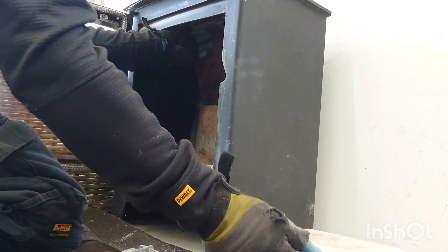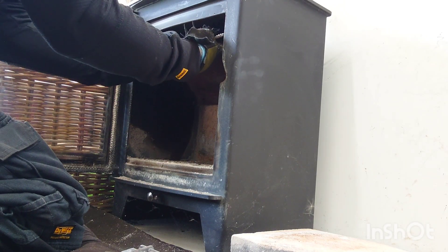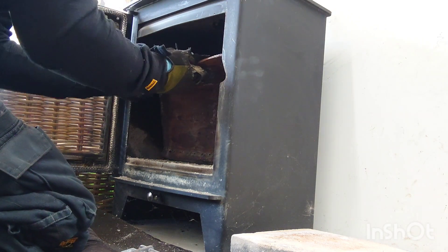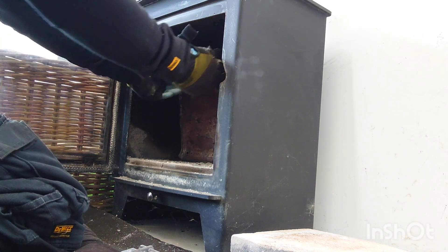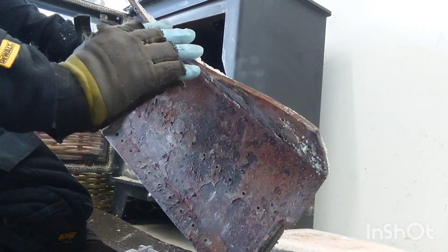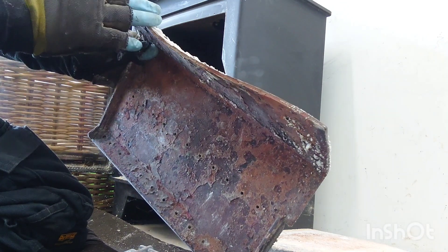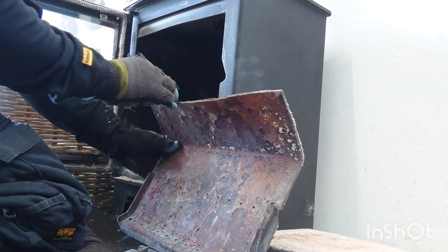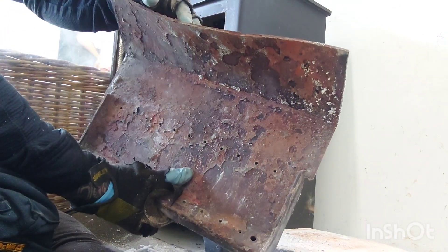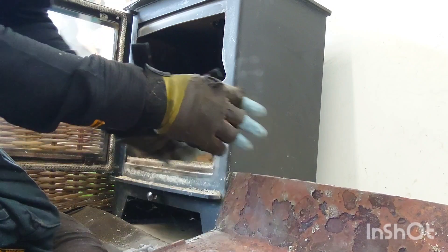You know exactly which way it goes around. With a lot of them you can just turn them around to get a new face, but this one's got a metal plate and as you can see it's very warped. What's happening is it's burning at too high a temperature. This hasn't got a thermometer on it, but I'd normally recommend having a thermometer on an appliance. It's got a bent baffle plate from burning at quite a high temperature.